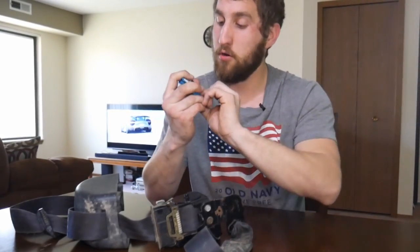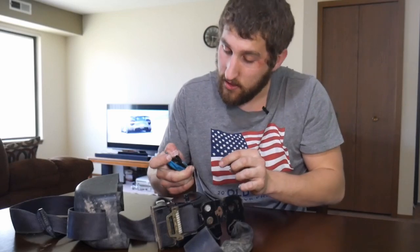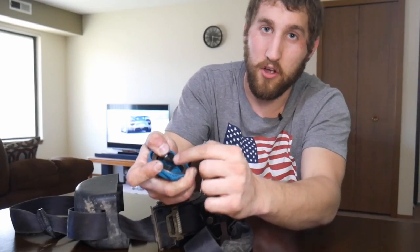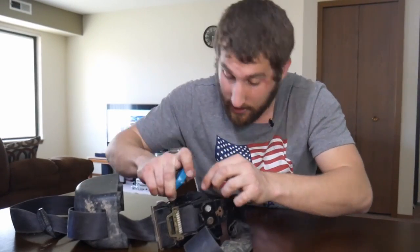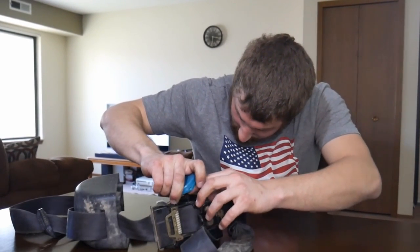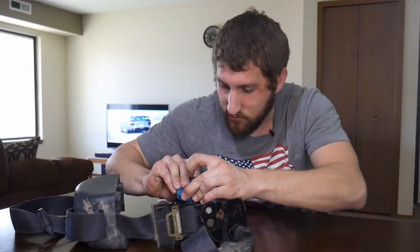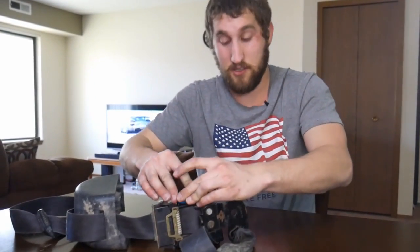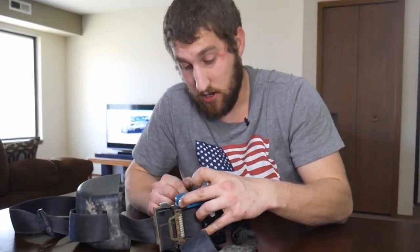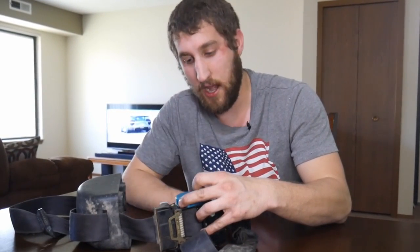Okay, so with your spring wound back up, it should look like that. And then the tough part is getting this to go on there correctly. So you got that little hook on the back side of this one, which needs to go into that slot. And then once you get it into the slot, you need to put it down in such a way that you don't lose everything you just did. So like that. Okay, so now you're back to the position you were at the beginning, where now you just need to rotate this and add the pressure back in.